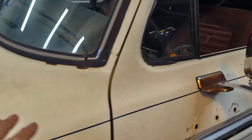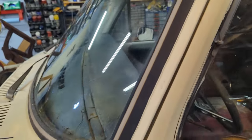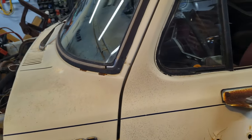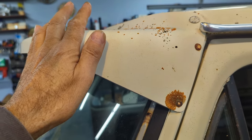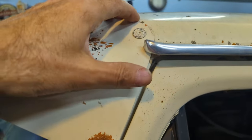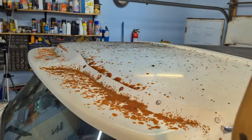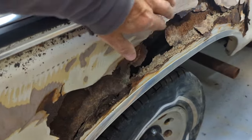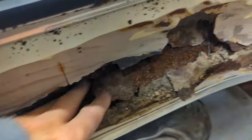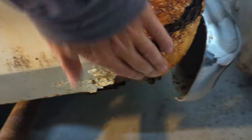Outside, this truck has been resprayed once — there's overspray on the weather stripping, a sign of not such a great paint job. Probably Maaco. The sun visor wouldn't have been factory installed, it's aftermarket, and it looks like it was all done around the same time. It's got optional moss on everything, there's some filler in the quarters, the inner rockers aren't great, the inner wheelhouse isn't great, and back on the corners it's pretty rough.